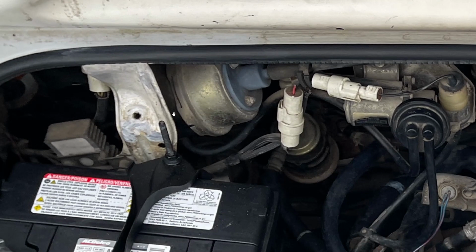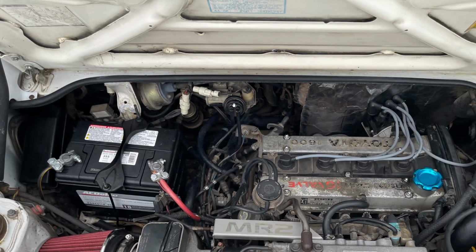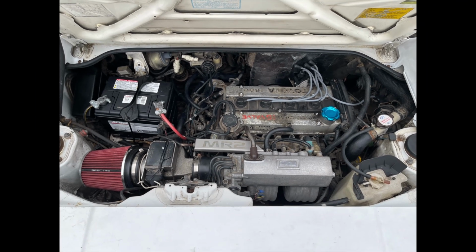There's 3 10mm bolts connecting this to the car. One is back here on the firewall, and then 2 are kind of behind this up top here. Once you take those out, same exact thing. You'll just have to remove this connector. Same thing with that little piece, pop it up and then take that off. I mean, that's really it. You'll have a little bit of this wiring harness dangling. I just tucked it on this side of the battery tray. And that is about it.